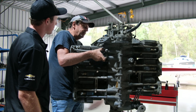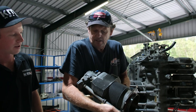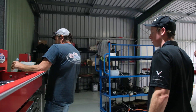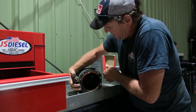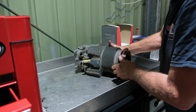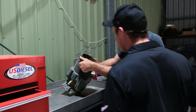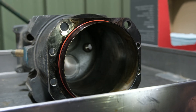She looks a bit corroded — a bit dry. There's the first cylinder off. It's complete — the rocker cover's still on, rocker shafts are still in, which we'll worry about pulling apart later. So let's sit it in the tray over here. We can now pull the tubes and pushrods out. Do they have to go with each one? They normally do if we're reusing that can, but we're replacing all that stuff. It actually doesn't look too bad inside.